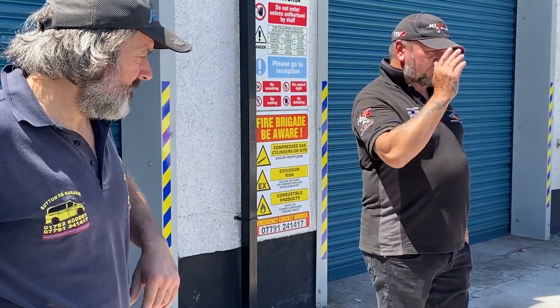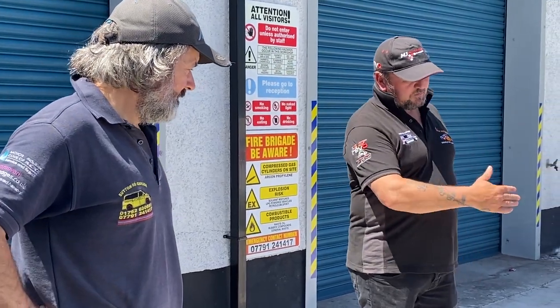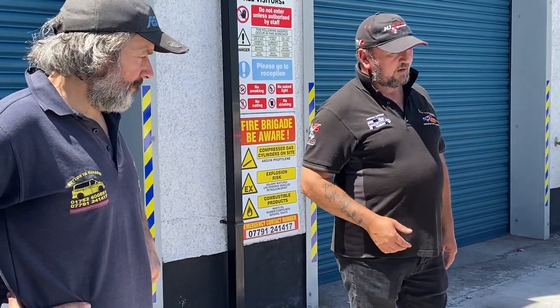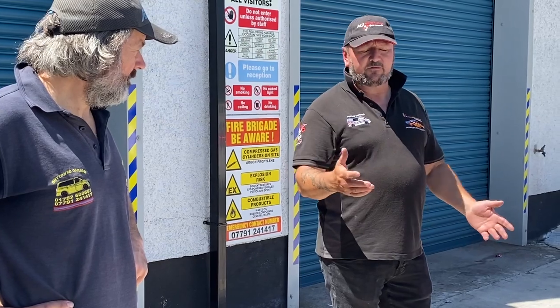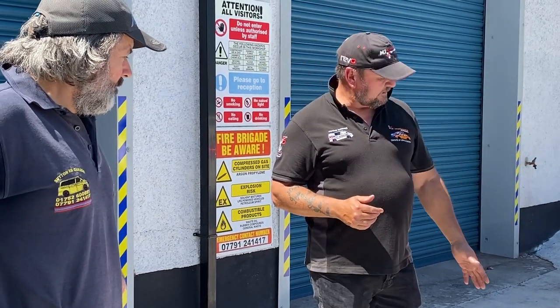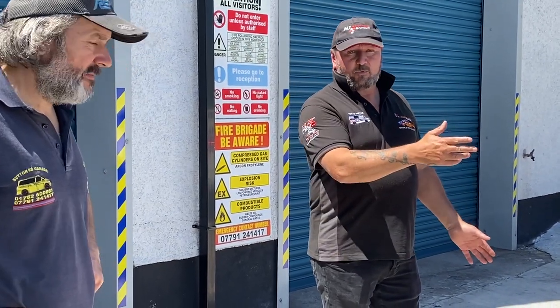The front brakes took all the brunt of the braking force, which doesn't help any car. If you can balance the braking between front and rear, and get it right, from front wheel drive to rear wheel drive it'll be different, but High Spec have got it spot on. It takes some pressure off the front brakes and helps reduce that braking oversteer and the nervousness. Definitely the nervousness. It also helps out the front brakes, so if they're both working together, your brakes are going to last longer.